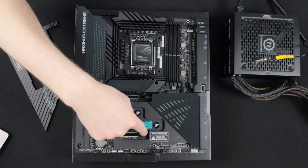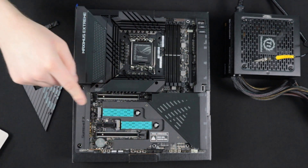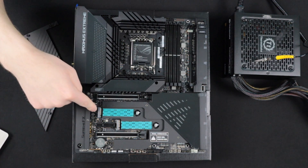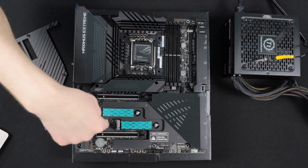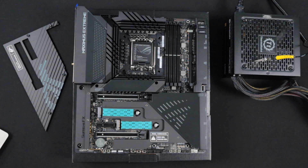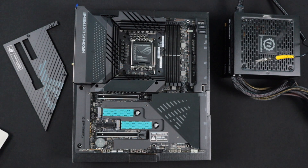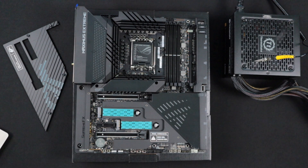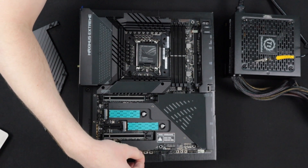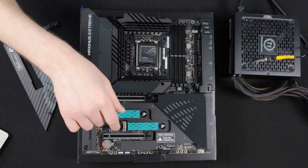Everything seems to be okay. We can check the latch and make sure that's working appropriately. Then we can also look at the PCIe 4.0 slot and make sure there are no bent pins inside of that connection. We can see more capacitors — we can check the audio capacitors over here and make sure nothing looks bent as well. This is the CMOS battery; it's a CR2032. Everything looks installed correctly with that, so we're good to go. Next, you can look at all of your headers and make sure the pins are nice and straight. You can check these switches and make sure they switch appropriately, and make sure that they are back in their default positions.